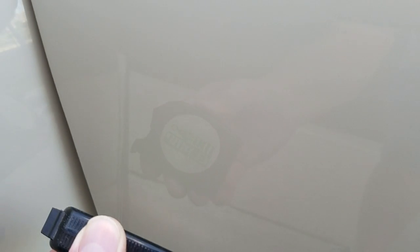Before we jump inside, looking at the reflective quality of the paint, sometimes it's hard to tell on a light-colored vehicle what the reflective quality is like. But this is definitely a base-clear job that's been very well sanded, and you can read in the reflection. Whoever color sanded the body did a pretty nice job. Down low, it looks the same as it does up high. Sometimes you get that effect of lazy knee syndrome down low, and in this case we don't have that issue.